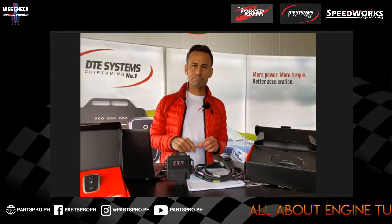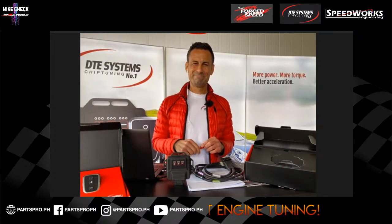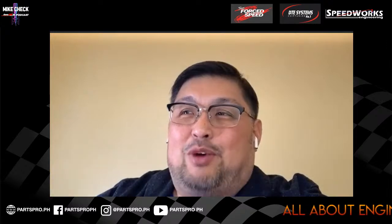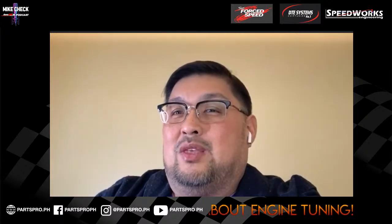Yeah, I think he's very much a crazy petrol head. I've known him for 25 years. I would refer him to either Leo or Jeff as well, because things like water methanol injection, things like installing a downpipe and whatever, these are things that you don't only do once. These are things that you do and redo and undo, and then you'll change things, like even just the nozzle size of the water meth. And when you change the nozzle size, you're changing again the duty cycle, and things I don't understand anymore. And with these things you have to have your tuner close to you, with at least a phone call, and someone who can service you, where he can put the car on a dyno and at least work on the car in a custom manner.